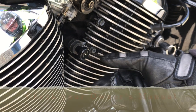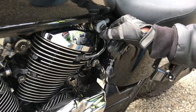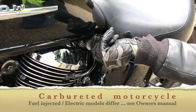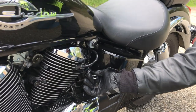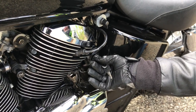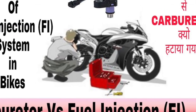Beyond your five basic controls, you also want to identify the following. Your choke, if you have a carbureted motorcycle — note the choke positions for on and off. Your fuel supply valve — note the different positions; most will have an off, an on, and a reserve for when you're running low on gas. Identify your ignition where you put the key, and note the positions it can be turned to. With a variety of bikes out there, including electric and fuel-injected bikes, always check your owner's manual for your specific operations.